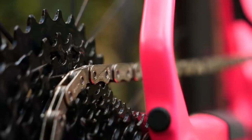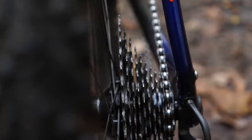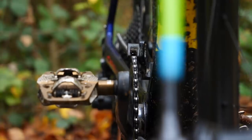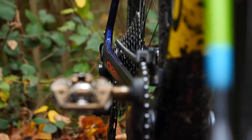The reason behind that is because the wax-based chain lubricant, as you say, is quite dry and hard to the touch, which means the rollers won't tend to feel particularly free when you're trying to move them with your fingers. It does serve a really good purpose when there's a big force applied to the chain when you're pedaling, and offers really low friction and protection against wear. Whilst it can seem counterproductive — because when you've got a completely clean chain with no oil or wax on it, you can feel the rollers and they rotate really freely — as soon as you apply any force or load through the chain, the roller will actually apply a great bit of friction to the rest of the chain and will wear prematurely.